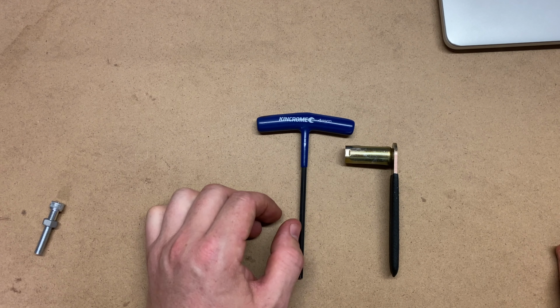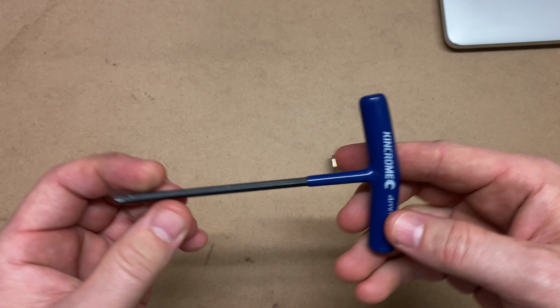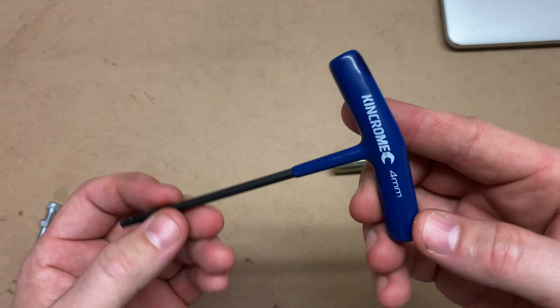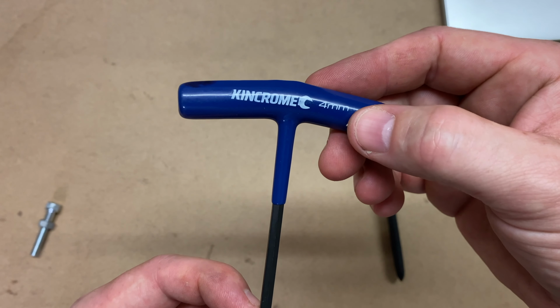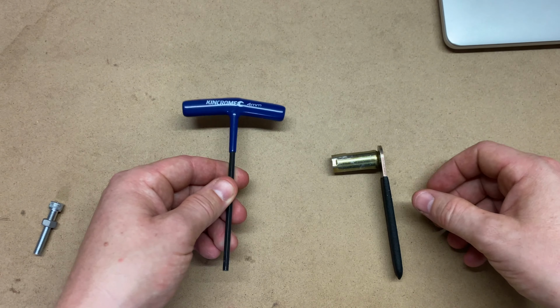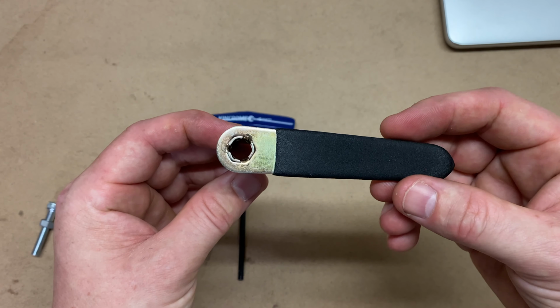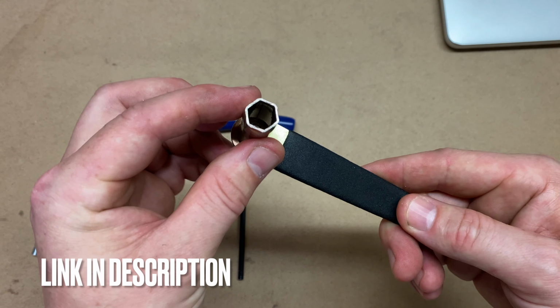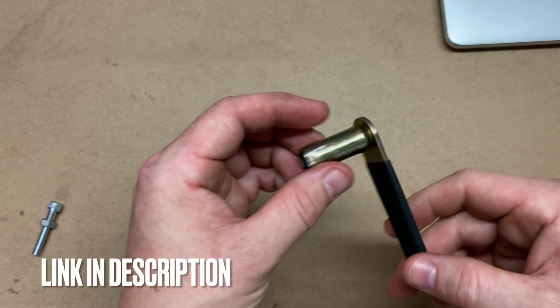So to adjust my clutch, I'll be using these two tools. Inside the clutch assembly I have a nut and a bolt, and the bolt is an Allen key that requires a 4mm Allen key T-bar, and the nut that we'll be adjusting requires this specialist clutch adjustment tool that I bought online. I'll leave the link in the description.